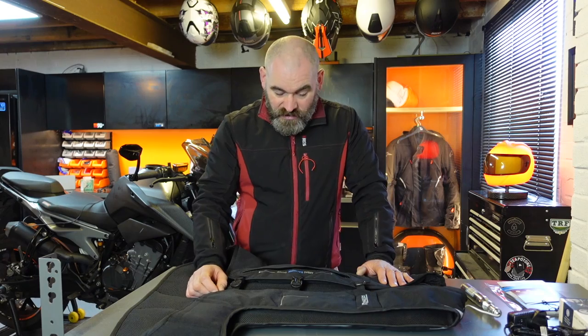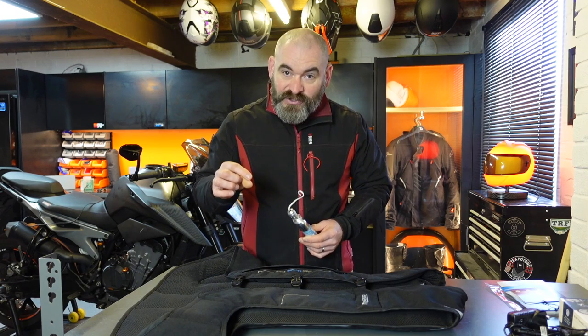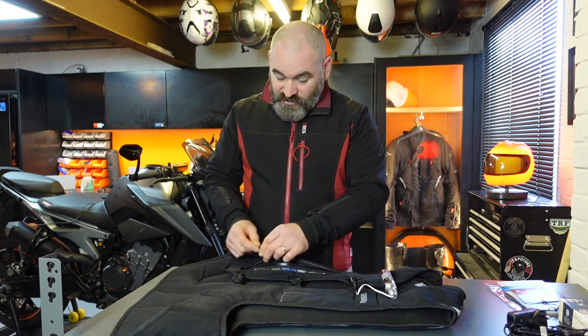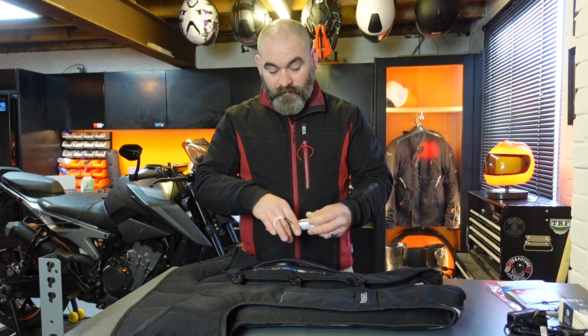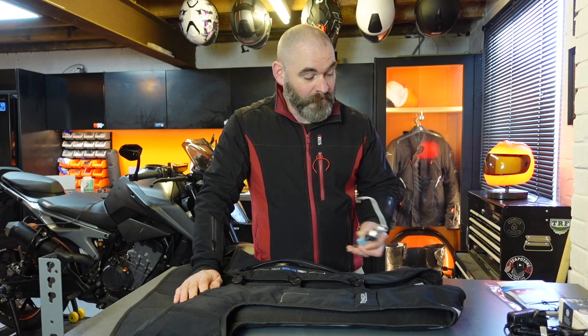In the unfortunate instance that you've come off the bike or had an accident and the vest has had to inflate, rather than with most airbag jackets where you have to get the jacket serviced each year and send it off to get it re-engaged, with the Helight jacket you just buy a new canister. Providing the jacket hasn't had any actual damage to the airbag element — so it hasn't got a hole in it effectively — you can just reset it yourself. You unplug it, unscrew the canister, recycle it properly, get your new canister, screw it in, plug it in, and the jacket is re-armed. It's as simple as that. For the E-Turtle, these canisters cost about 50 quid.